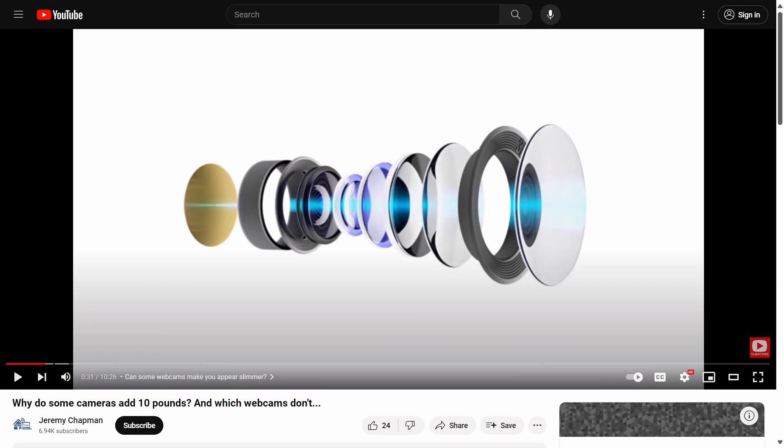The first thing I noticed with the default image is that it has a really wide 90-degree field of view. The last couple of cheap cameras I tested had somewhere in the 75 to 80-degree field of view — this is more along the lines of 90-plus degrees. If you watched my other video on why some cameras have that slimming effect, that's because of the different lens optics of a wide-angle camera. This one actually has that, where the sides are a bit rounded, but they do a little bit of lens correction to make the lines more or less vertical.